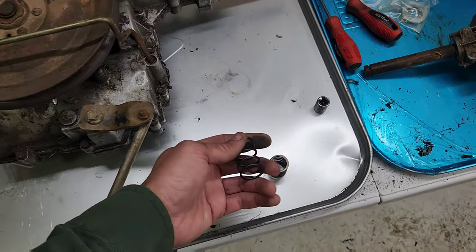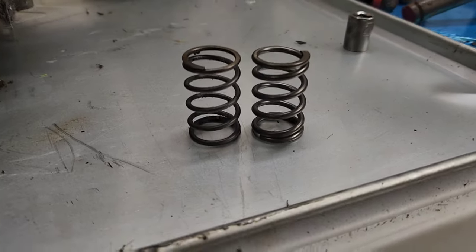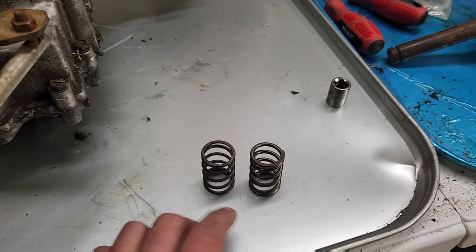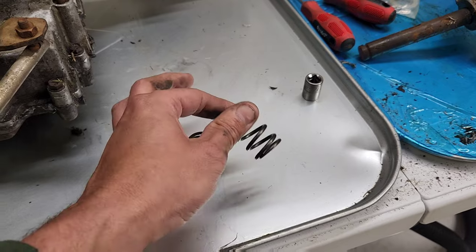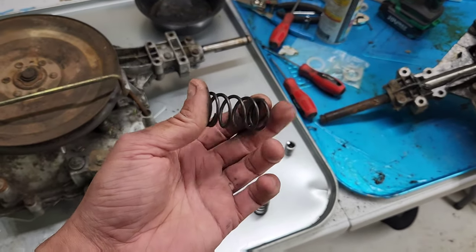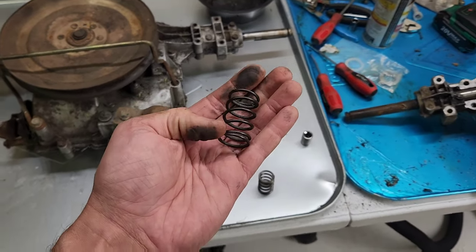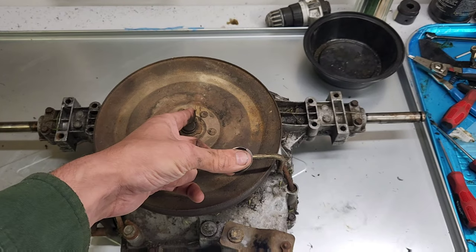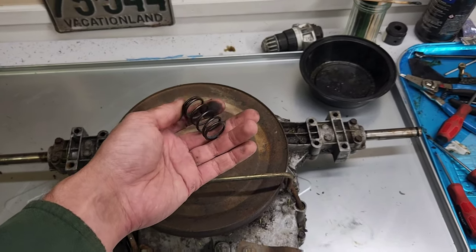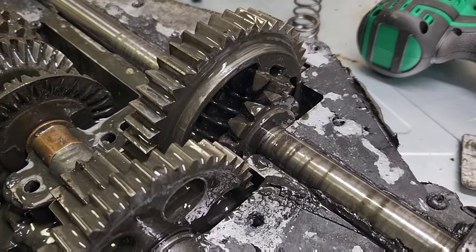Now, what's up with the weird springs? You can see the difference coming down next to them — this one I can move, this one I can't. In the description below will be a link for buying these as an upgrade kit. This spring is out of a single-cylinder Intek, maybe a 14 or 15 horsepower, but they all use the same basic 16-pound spring all the way up through the 20s and 21s. Inside the differential is one of these springs, which is why earlier we were able to do halfway decent on the off-road area with turf savers.